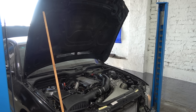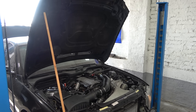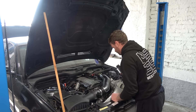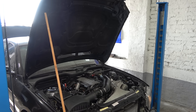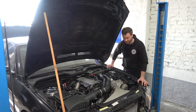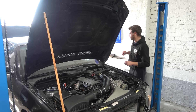We're going to wait for it to reach operating temperature. Turning the steering wheel from lock to lock a couple of times. We're at 91 degrees — with that thermostat it should run to about 95. Power steering pump stopped making noise. The smoke is pretty much gone. The clicking you hear is normal — mostly injectors and the mechanical workings of the engine. Good old Alpina H1 engine and the supercharger. I think we're going to shut it down now, check for leaks underneath, drain the oil, replace the filter, and get fresh stuff in. It's at 95 now.